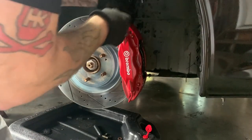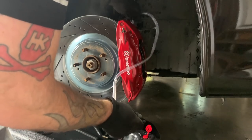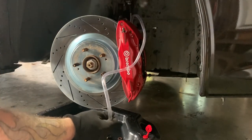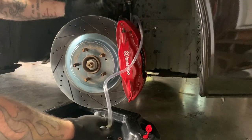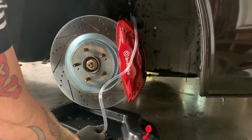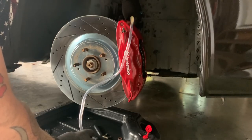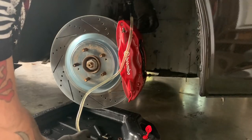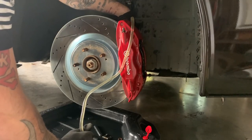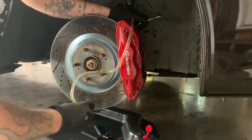I've got an 11mm that I'm going to put on the back side for the inside of the calipers - what we're going to do first. I'll just attach my little hose here. I'm basically going to open this up, he's going to push on the brake, and you're going to see the fluid come out. We put some new fluid in there too - it's a little bit lighter, so there'll be a little bit of color change hopefully. You want to get rid of any air bubbles caught up in the brake line since these are brand new lines with no fluid in them. I open... closed... open again... closed. No air bubbles there, so we're good to go on this side.